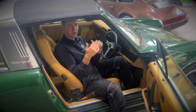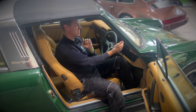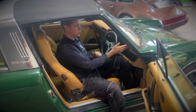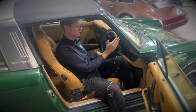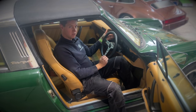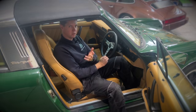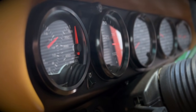It's also a live dial for rapid charging. So if you stop at a CCS rapid charger, you can actually see how fast you're charging, which is really cool as well. You've also got a temperature gauge on the side here, so it tells you how efficiently the battery pack and the drive unit are operating with temperatures. You've got your state of charge on the side here as well, from 0 to 100%, and then you've got your battery voltages on the side there as well, just to say how things are performing. So your dials don't look any different.